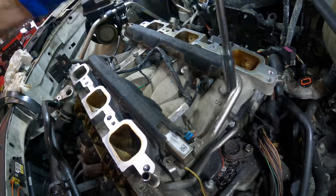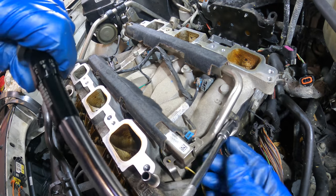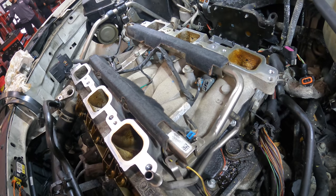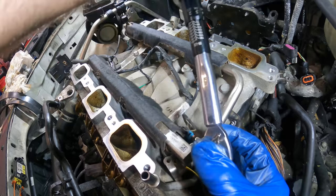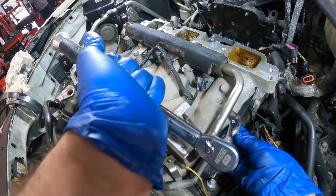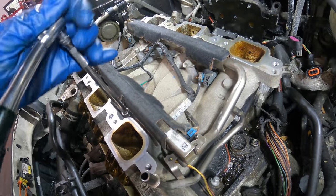That's five. Evan, I think I can kind of reach that one, maybe, probably not. That's not going to work. All right, I'm going to wing that one with a wrench. Ooh, maybe shorter socket. Let's try that. See if I can get in there on that guy. It's a wobbly drive. Almost. Okay, after 62, we step it up to 115 inch pounds.